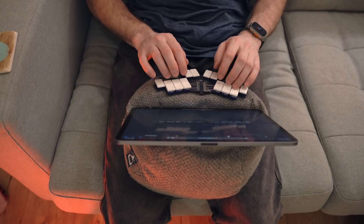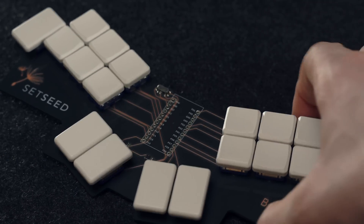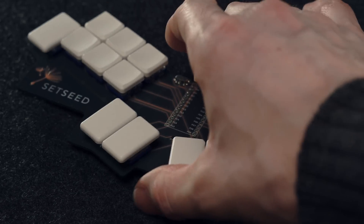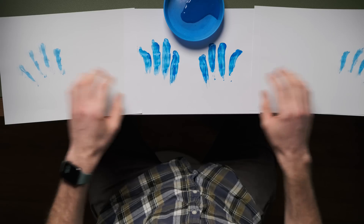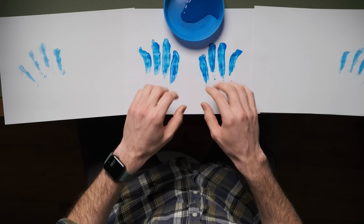With this portable keyboard, the two halves are going to be close together because it's a fixed board, and that means my forearms are creating an inverted V shape. Because the column layout can be in line with my forearms due to that pinky key, the inverted V is the shape of the layout I've gone for here. Getting your head around the relationship between the length of your little finger, the stagger on the pinky key, and that column-to-forearm angle is something that's taken me a while, and I'll do another video on that.